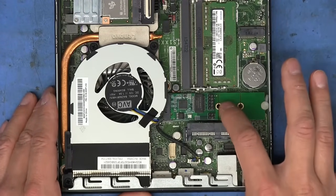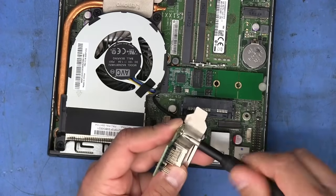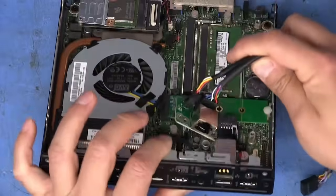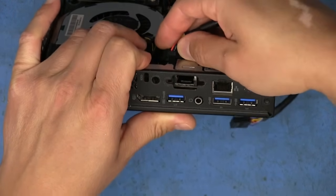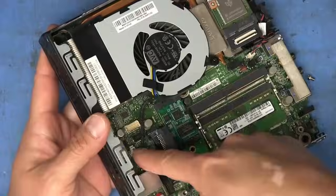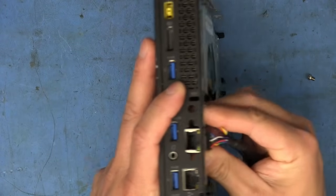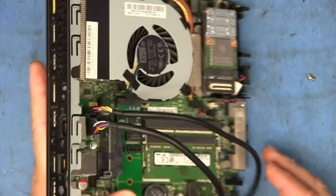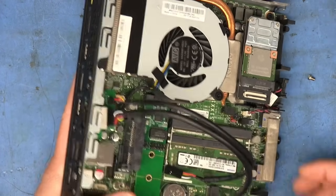But not only are they a problem here on the actual interface card itself, let's remove the jack from this back bracket, and let's plug these in here just for the example. Now you can see that if we were to put this jack here in the back, hey, that rhymes. Well, first of all, I'm having a hard time trying to slide it in because the pins down here are interfering with some of this stuff down here. But if we can get it to go all the way in like that, yeah, you see, this is the problem. You can't put the case on, which I guess wouldn't be a big deal if you wanted to leave it open, and then you could just plug these in, and it'll work.